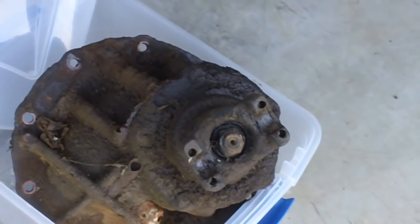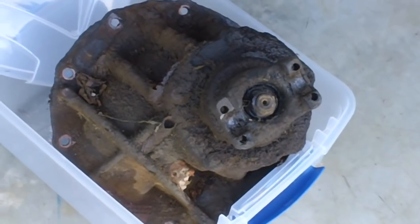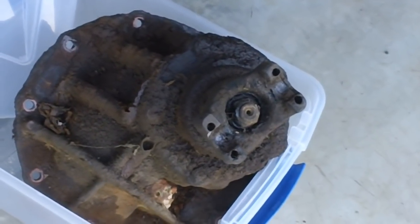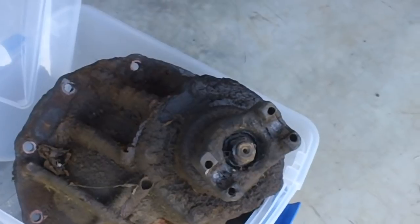It takes 200 to 300 foot-pounds of torque to tighten that thing up the way it's supposed to be. You have to do what's called a preload on it. I don't have the right tools, and I don't have the strength to apply 200 foot-pounds of anything, maybe even more than 200, 300 foot-pounds. So let's get her cleaned up and get her looked at, but it will have to have a new seal. And it may even need a new bearing and a new race.